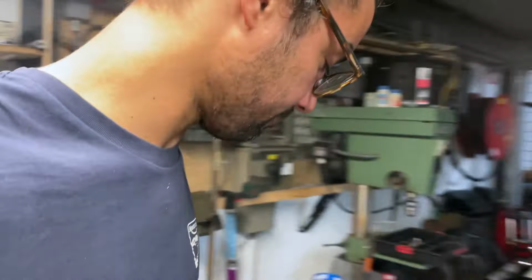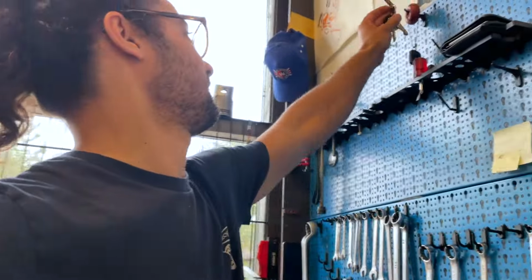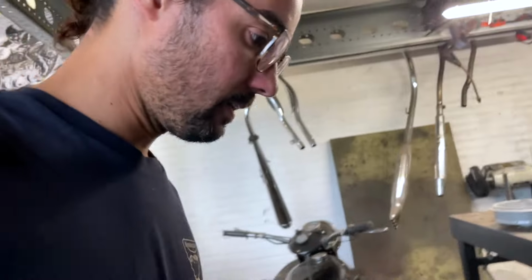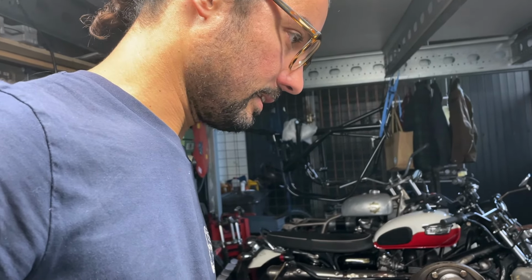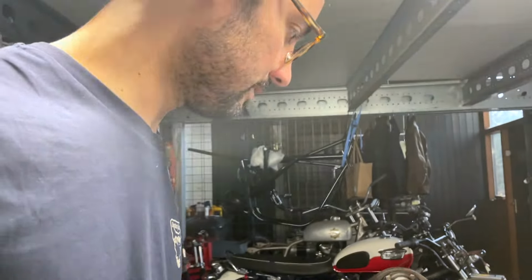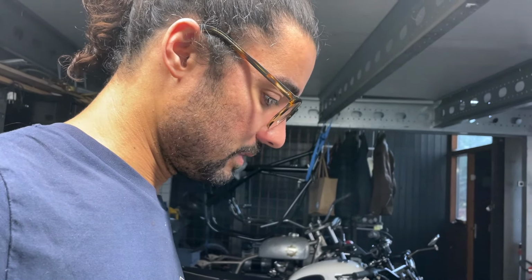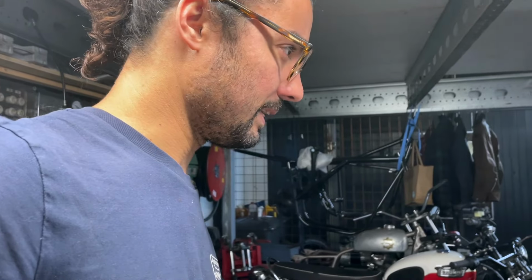Okay, so Friday morning, yesterday the Royal Enfield was delivered, so voila, nice, but seems that, of course, the owner took the motorcycle on the highway for almost about 2 hours, maybe a little bit more. And after that he had some oil leaking through the breather of the engine, I guess. I still didn't get the video, so I'm waiting for that. Through the breather was a lot of oil, and this morning when he checked the oil level, the engine was almost empty.